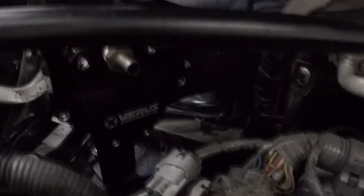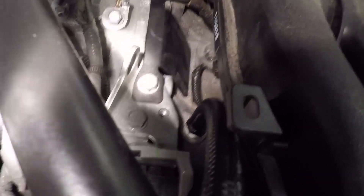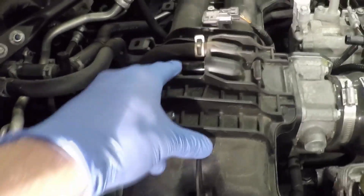Since I'm doing an OEM-type naturally aspirated install, I removed the black MPT that was on the used unit and installed the factory PCV from the engine block. Going left to right on the plumbing: the far left side is plumbed down to the NPT installed into the engine block. Then the PCV valve uses the smaller 3/8-inch hose from the kit, with a hose adapter to step up to the half-inch hose, plumbed directly into the intake manifold.